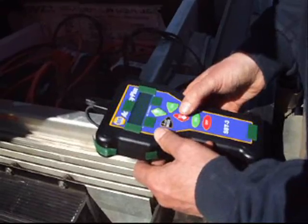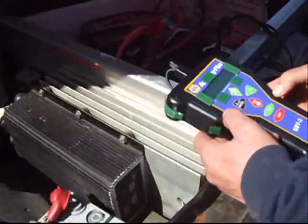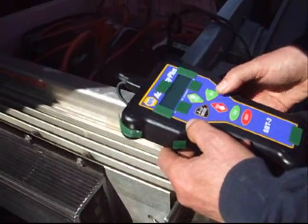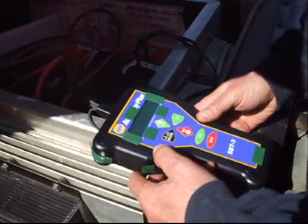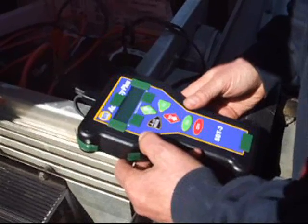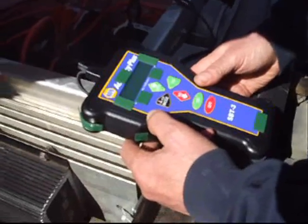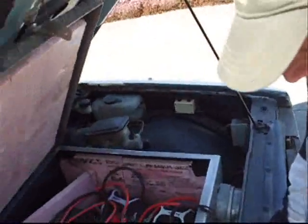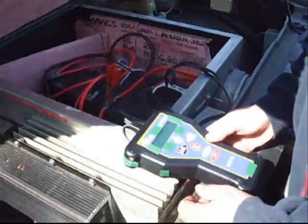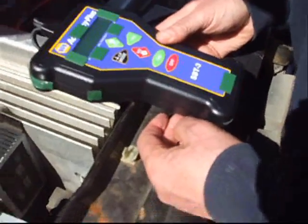Use the down arrow to bring it down to 55. I would bring it down to 50, because manufacturers always overrate their batteries. Press go. Applying the first load, then it needs a second data point — that's a second load. It plots the data points and compares to its profile. Based on the recovery it gets a third data point, then it gives you its result: good battery.